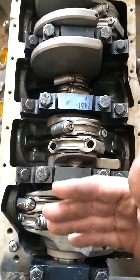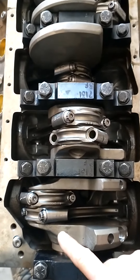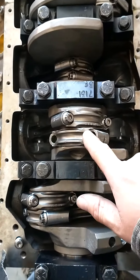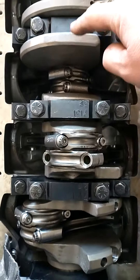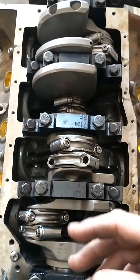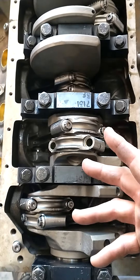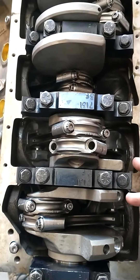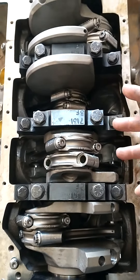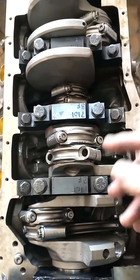General Motors — the reason you have 1, 3, 5, 7 on your driver's side is because you just go right down the line on the crankshaft: 1, 2, 3, 4, 5, 6, 7, 8. That is your General Motors, Mopar — just about everybody else on the planet does that.